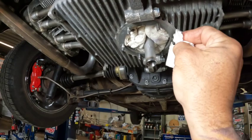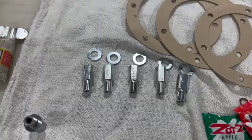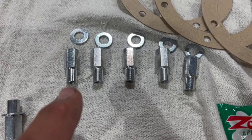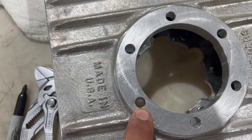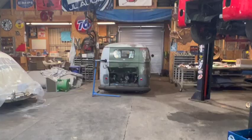You can see that I've put those together. It's a little bit of a tight fit — you do have to put them on there fairly firmly, you may have to tap a little bit. If they don't go on, you can hit them on with a socket. That collar or shoulder indexes into the case and it helps hold the sump in place. You don't have to change out your studs like you do on most sumps. I really like this — I have this exact sump on my bus and it sits pretty low, and it's still clear.